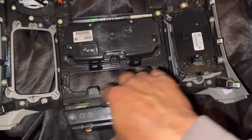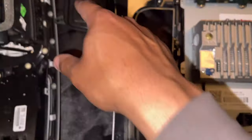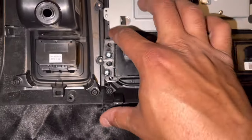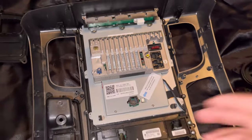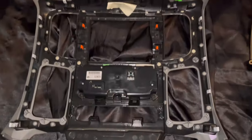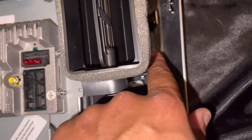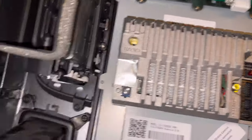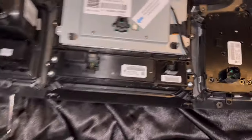Next I took out my middle piece. I used the four stainless screws that came with the kit to hold it into the bracket, then used the originals to mount the bracket — lift and check, and there it is, a flush look. Next, the little four-wheel drive shifter: four original screws swapped on — clean look. Now I've taken both vents off. For the vents you're going to need your T20 — just one T20 on each — and then these little clips all along the edge that you just pry off, and that releases it.